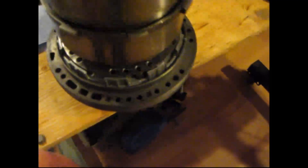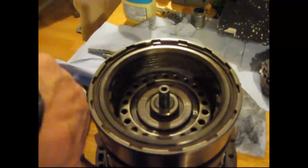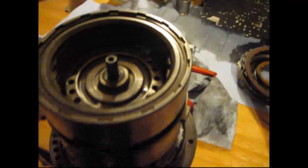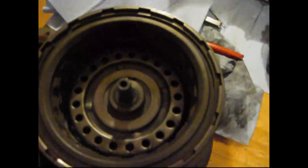Now with the forward clutch down, you're going to test in this hole right here. When you do the check, be sure your nozzle is pushed down really good so you don't get any air leaks. New clutches — from what I understand, that's supposed to be the good sign, the okay sign to move on to the next step.